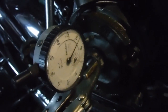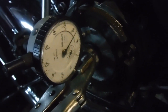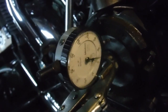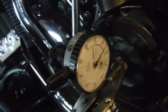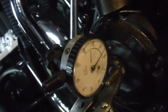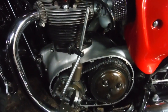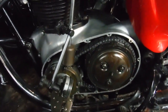Sorry — 0.15 of a millimeter, which is six thousandths of an inch. We're actually getting a little bit over that; two full divisions would equate to eight thousandths of an inch, but we're definitely seeing at least six there, which is twice the permissible maximum that BSA recommend. It's not as bad as I've seen on some engines, which have been running long enough to get up to nearly a millimeter and a half of end float — but that's terrible, you definitely do not want that.